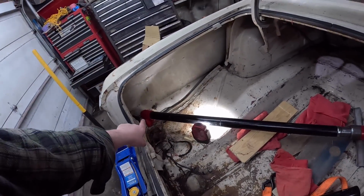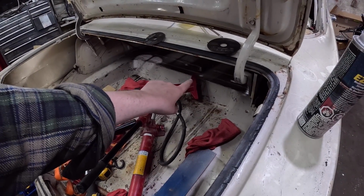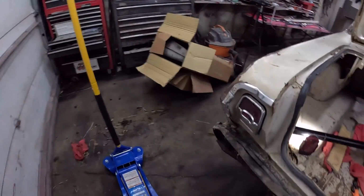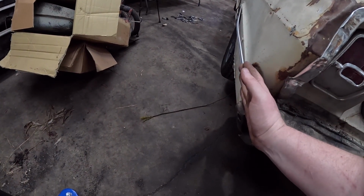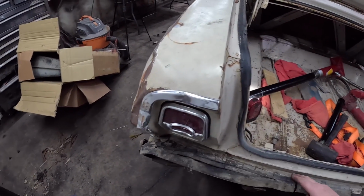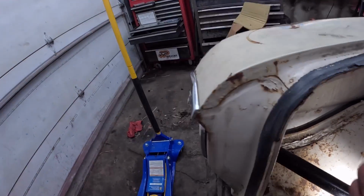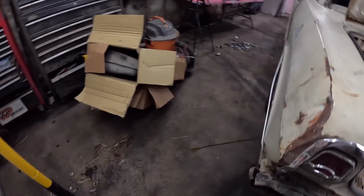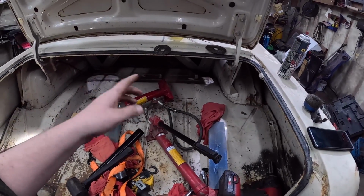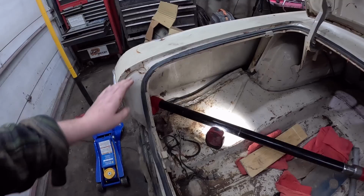Now there's a whole bunch of different tips and ends and stuff like that, which we might get involved in. Now what we're trying to do, I've got it jammed up against that spare tire hoop there, or whatever that is. So hopefully we can have an angle push out that way, because what's happened is this is going in this way. So we're going to try and push it out. Now the quarter panel wrinkled, but what really happened was this back structure panel got bent in. So if we can push right on the edge here, if that pulls out, in theory it should pull the quarter panel that way as well. The real issue is going to be, will it be able to hold on that, or is it going to go all cattywampus? So we'll get you on the tripod and we'll start working this thing out.